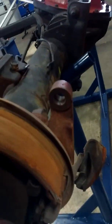The last thing I'm going to show you, of course, is your parking brake pads. And you got an adjuster down in here. You got your little spring for that. This kind of looks like a drum brake assembly, but this is actually your emergency brake or parking brake pads, whatever you want to call it. And you just look for damage around them, make sure they're not cracking, not falling off. They can separate actually from this pad from heat, so you want to make sure they're on there, they're not moving around and stuff like that.